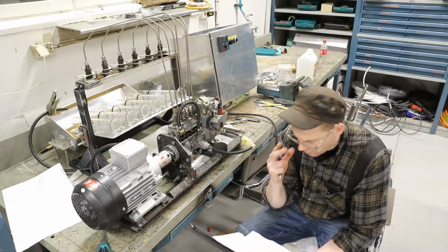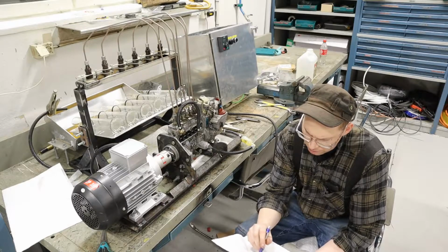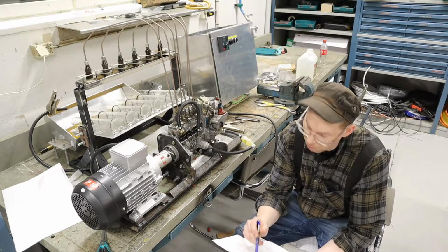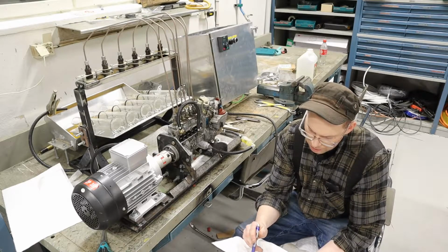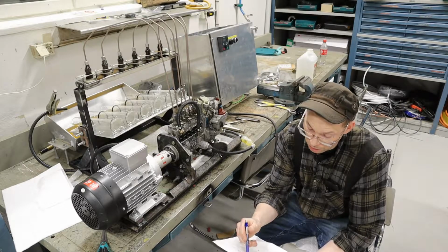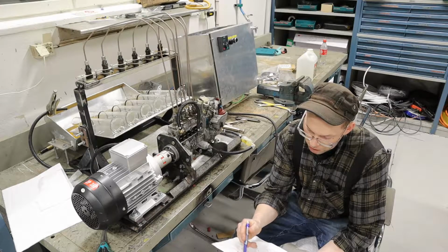It was a little bit inconsistent. On the first cylinder, I got a little bit higher: 47, 45, 45 milliliters. Second cylinder, 44, 43, 42. I have run it three times now. 42, 42, 41 on number three.